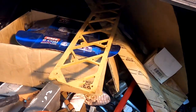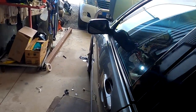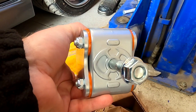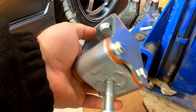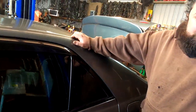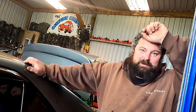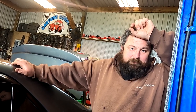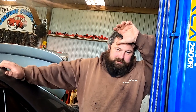There's spare parts in the car from different builds. He used bits from it for the engine mounts - Excessive Engineering mounts, though they're actually quite sparse. Fitting an auto would stop them breaking. The gearbox is an R154 - bought brand new, then had a Marlin Crawler upgrade kit fitted. They stripped it and put in thrust washers, billet center plates, and selector forks after only six hours.